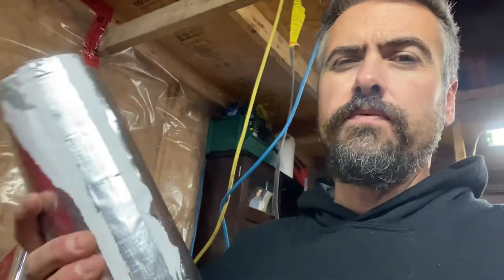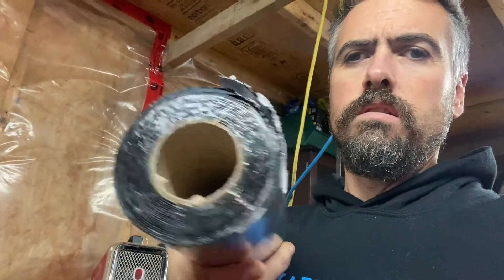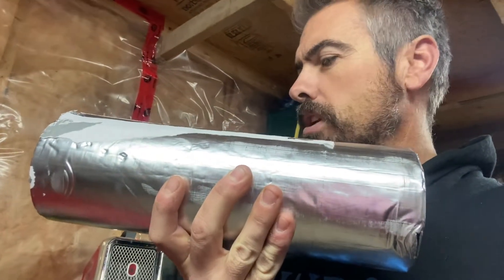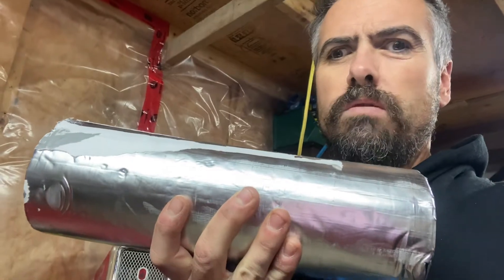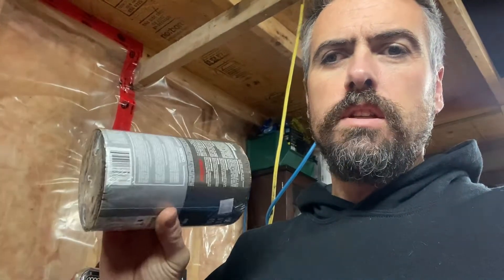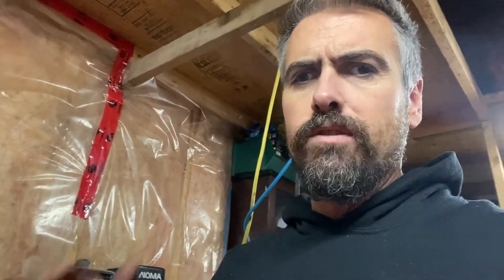What I have here - I get two different sizes. There's this one, which I think is 12 inches wide by like 16 feet, and then I have a smaller one that I use for the trans tunnels. The stuff is called Resisto. It's like a waterproof membrane for roofing. You put this all on your floors - even if your carpet got soaked from your shoes or whatever, it's going to protect the floors, if you do it properly.